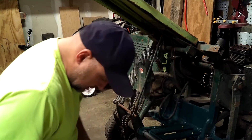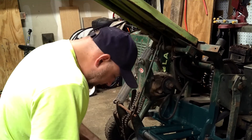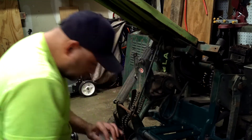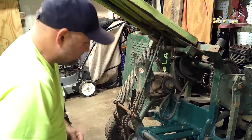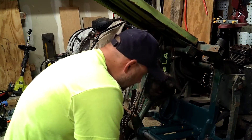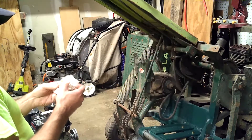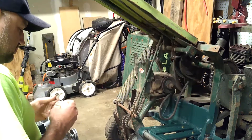I bought washers — lots and lots of washers. I should probably put those on. I also got the hardened lock washers with the hardened bolts, and I got the hardened nuts to go with the hardened bolts — all grade eights. I also got longer bolts for the front of this. I went up a half an inch, which was a size up.